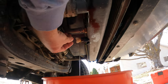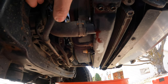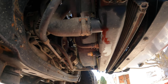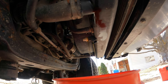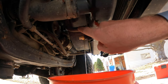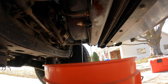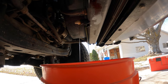For peace of mind and another 225,000 miles, I have no problem putting $450 into my truck. I'm gonna let this drain out for quite a while — once that's done we pop this lower hose off and make sure all of it can flow out of there, including what's in the engine. This one has transmission fluid coming in on this line and the same with the other one over there, so I'm gonna get another bucket and crack those open to collect that fluid, because you don't want to mix those two.